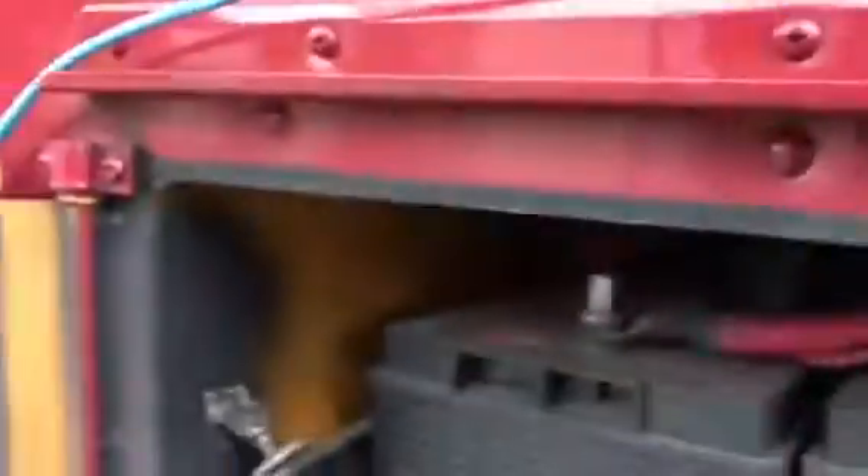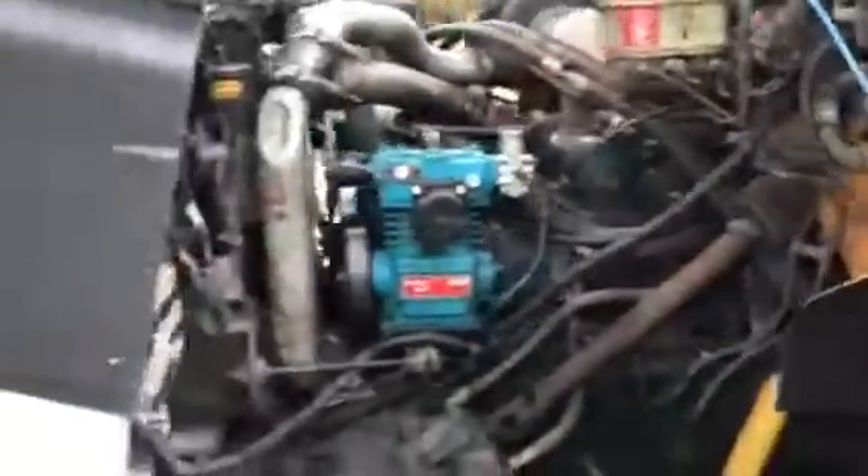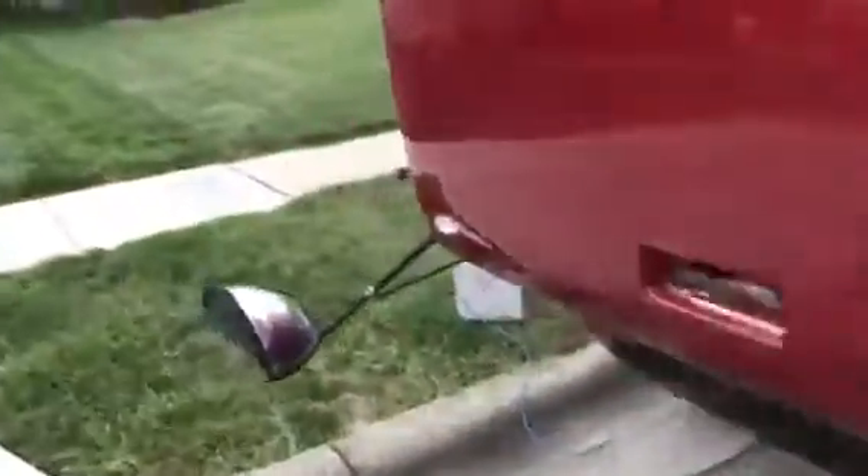I thought if I hook the wires up, let's just see what happens. This is just for a driveway test. What I did is connect the white to the white-orange and the yellow to the orange wire on a piece of cat5 wire. Cat5 works well because it's twisted pair, and CAN bus should be twisted pair.